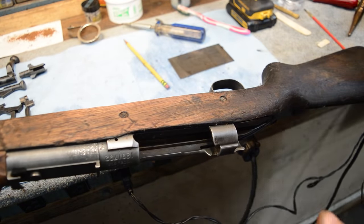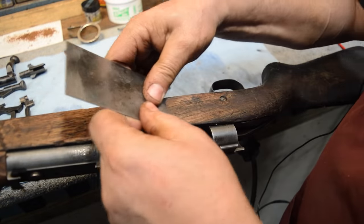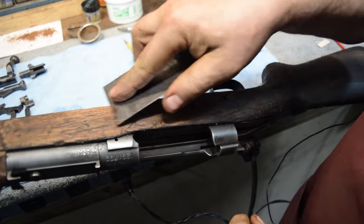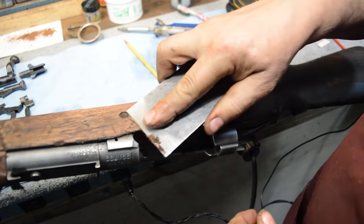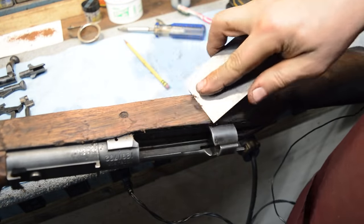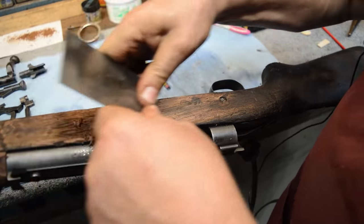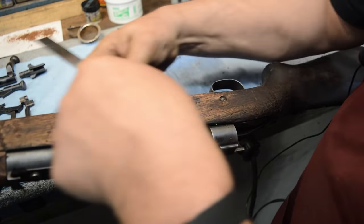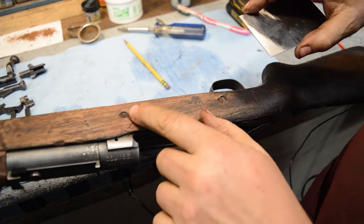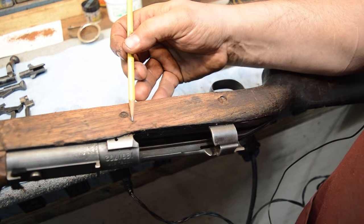All right, so as you can see here, now we've come to a second level, we can go after this a little bit more. And we're bringing that crack up to the surface so that we did not have to remove all sorts of extraneous crap around it. I'm sorry, I'm reaching in front. Hang on a second here. Okay, that dent is damn near all the way gone. I mean, it doesn't even have any depth.